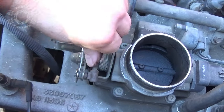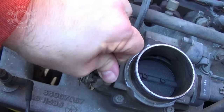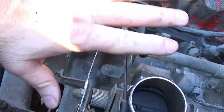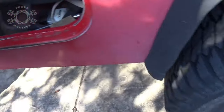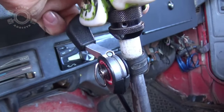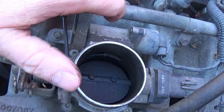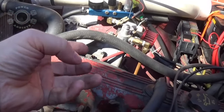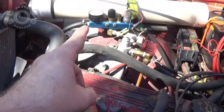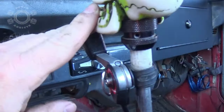To begin with, get your throttle cable off here. Most of the time you can come, pull, and wiggle it'll pop off. This is the cable for my hand throttle. When I pull up on the lever it opens the throttle blades on the throttle body, creating a high idle situation. I've got my onboard air compressor — if I need that extra charge of air from the higher RPMs I'll kick the throttle up, which puts out more air.